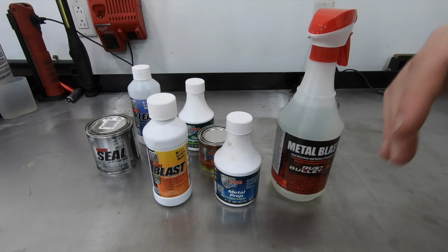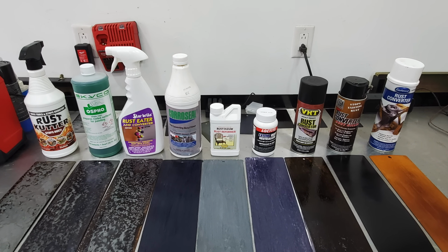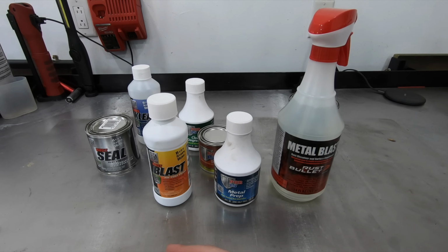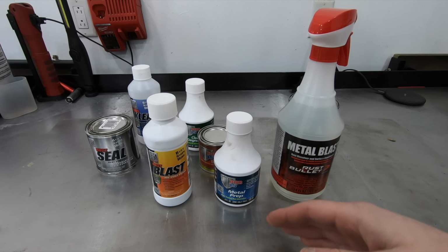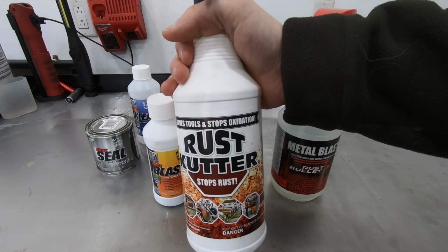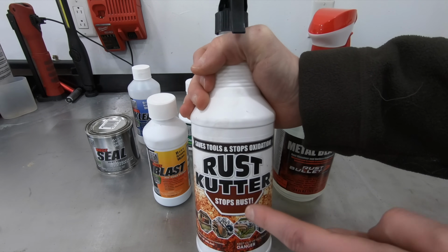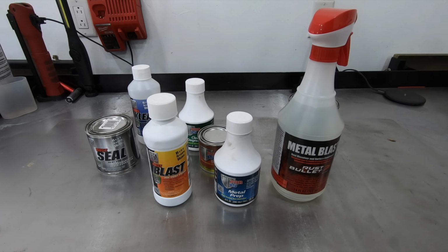If you guys take a look at my last video that I just shot, I'll put a card up in the corner to it. It's on rust converters, and the best rust converter to take rust that is iron oxide and turn it into iron phosphate, the best products out on the market for rust converters are phosphoric acid products. The reason that I'm bringing all of this up is because the best product that I found out of that video was a product called Rust Cutter. Rust Cutter has 3 times the amount of phosphoric acid as POR-15, the KBS, and it has twice the amount as the Rust Bullet. So in my opinion, I don't think any one of these make a huge difference in the performance of the coating.